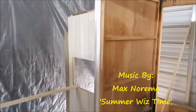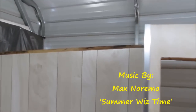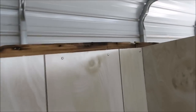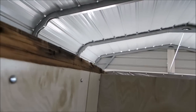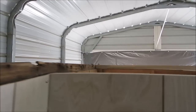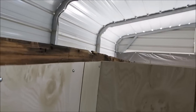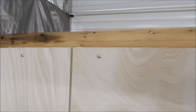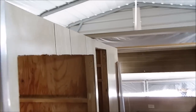We're beginning to get ready for the ceiling now and I had to make everything level, had to sand with the belt sander all along the edges here. This is that rabbited edge that you heard so much about in the last videos. I was helping Christina — she had to create that edge in a couple of places where it's not in great shape, but that's okay, it won't matter. I belt sanded everything down so that the paneling was level with the top in preparation for the gimp all the way around.